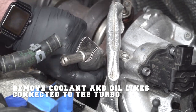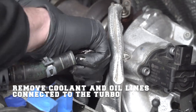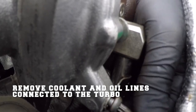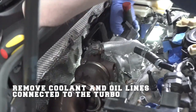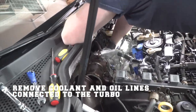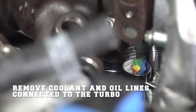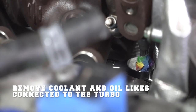Next I moved to the coolant line up front. Once I removed the coolant line from the engine, I figured it was easy enough to take off and give me more room when pulling the turbo out. Then I moved to the rear coolant line — please note that one has two retaining bolts. And then finally, the oil line on the bottom. No joke, we probably spent an hour to an hour and a half trying to remove this. The magic stick got caught on the wastegate actuator, which was another pain. I honestly don't remember exactly how we got it off — you're just going to have to work at it.